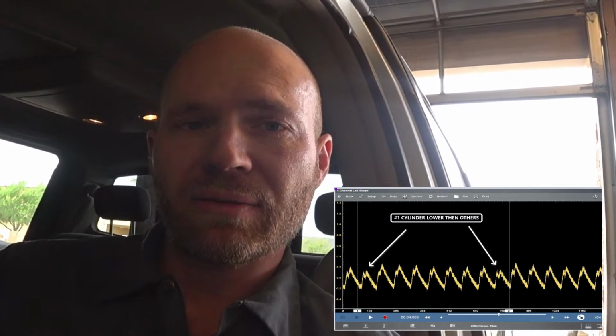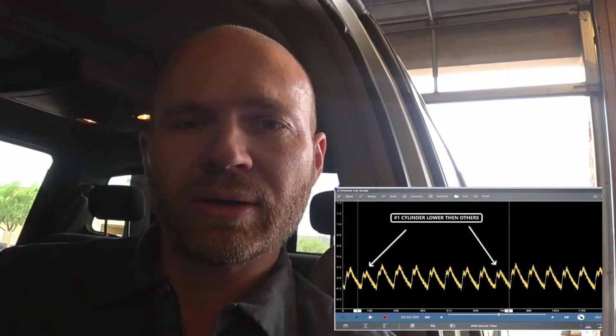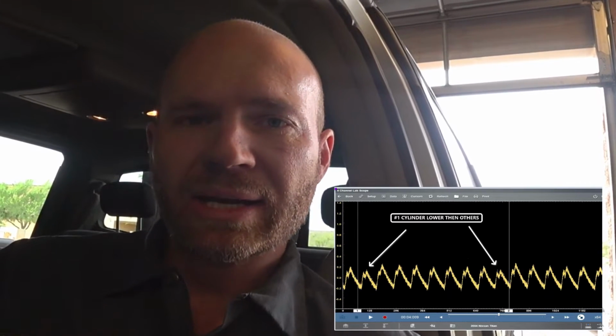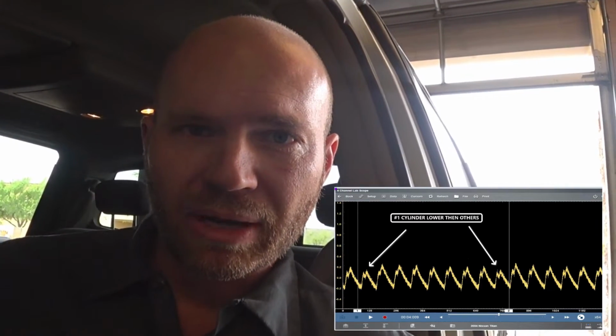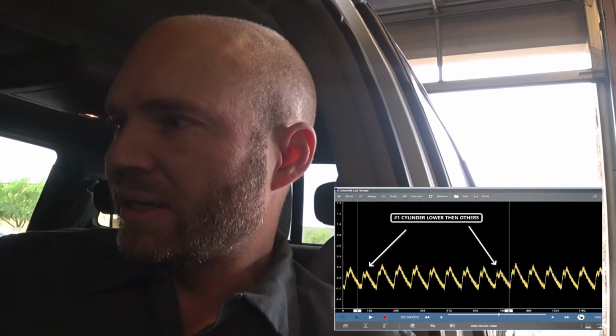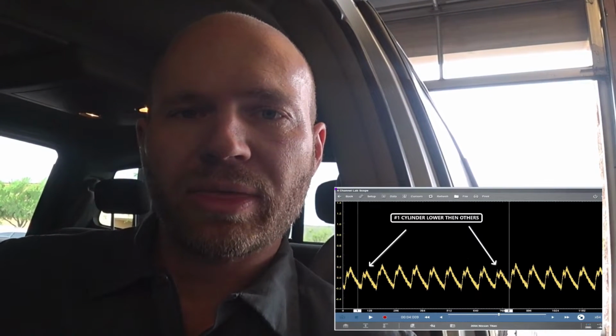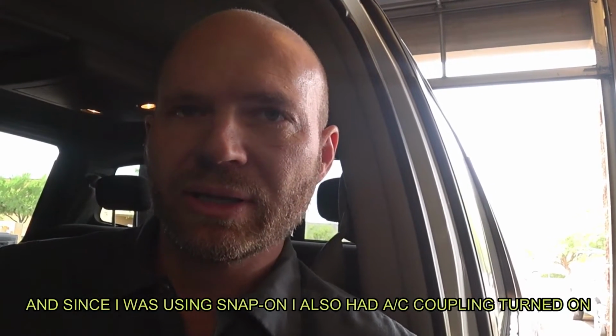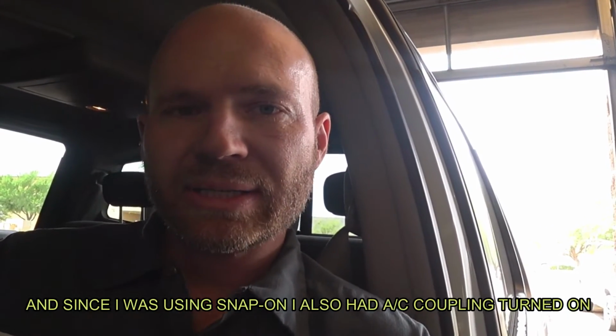It does have a misfire. It had a P0301 misfire code, cylinder one misfire. First thing I did, grabbed the breakout box, the BOB, and did the RC test with the voltage reading inverted. I swapped the two leads, and you can see that one is just a little bit lower. So I wanted to get an amperage measurement of the coils and go from there.